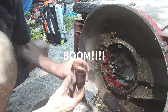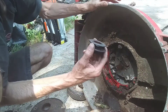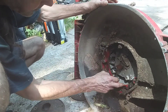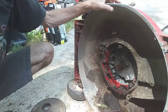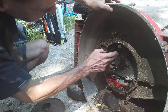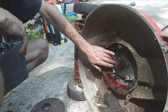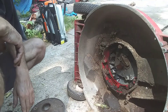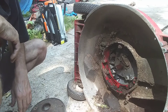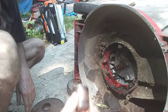And that's off. That's the hard part, because without getting this off you can't get the belt pulley off, and there's no sense in taking the engine off because you're not going to get the crankcase apart. So now we've got it where we want it. I think this one's only got three bolts that hold it in — one, two, and three. We're going to take that off in the part three video, which I may put out tomorrow. We'll be getting this engine off, popping the cover off, and taking a look inside the engine. Just a trick on how to get these pulleys off.